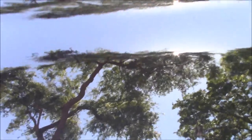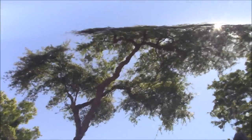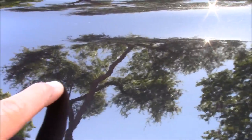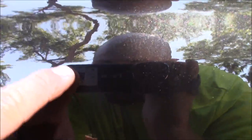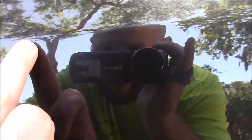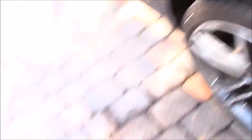So I went with their cutting green pad and Infinite Cut, and I was able to get most of that scratch out. If you look carefully you will see just a faint bit of it left, but none over here — that one was gone. But this scratch is extremely deep, and it's all about trusting your gut. You can barely see it but it's there, and my gut says stop. In fact I probably should have stopped two times ago but I lucked out. This scratch goes up into that edge — just remember, the closer you get to an edge the thinner the paint is. Fortunately BMWs tend to have plenty of clear and it's generally a pleasure to work with. The scratch starts here and goes all the way down, and as you can see Infinite Cut handled its business, especially once I got the correct combo.